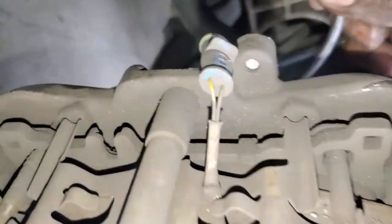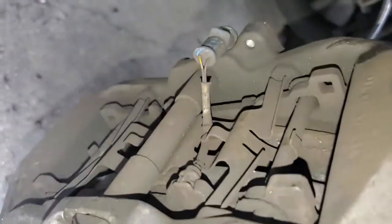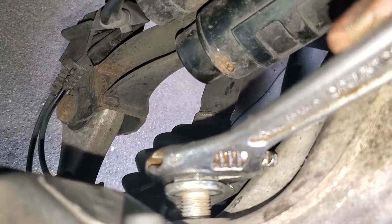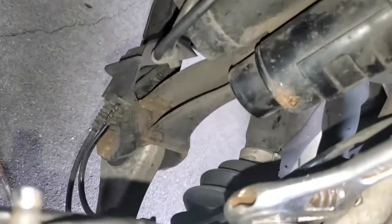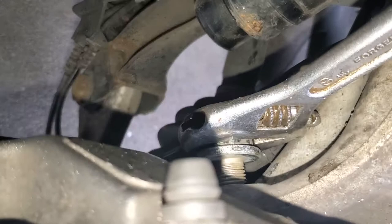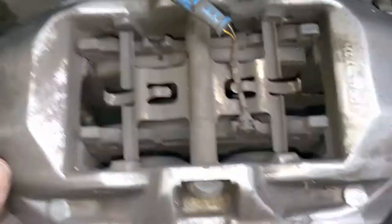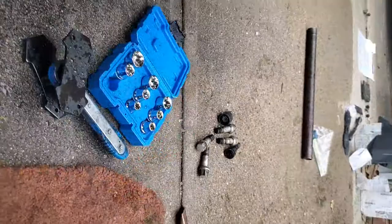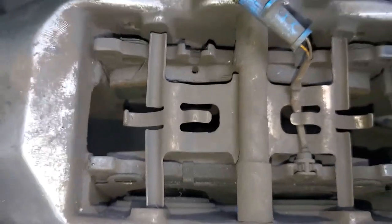Same thing we did on the driver side brakes, we're going to do everything here on the passenger side — you have a little bit more work, but nonetheless the goal is to change the brake pad. One tip which is also helpful: the half-inch socket might hit against the strut — the air strut of the Mercedes. So it's always better to get an adjustable wrench to loosen this top bolt, same thing on the driver side. Now we have everything off — the caliper, the brake sensor. We're basically just going to disassemble, use the wrench to push the piston back in, insert the new brake pad, and reassemble everything.